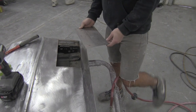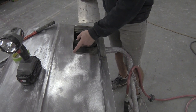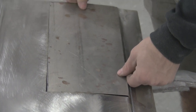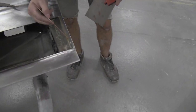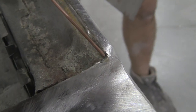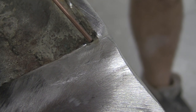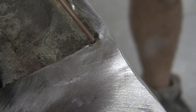From here you should be pretty close to setting your piece in there. You're probably going to need to take a file or something and clean out the corners a little bit — they're going to be a little bit rounded from your cut-off wheel. In an area like this where there's metal from the other side of the door in the way, you can't really cut the corners very square. It's easier to just take your patch panel and round the corners off a little bit. You definitely don't want to have to hammer your patch panel into place before you weld it up — that just makes things terrible.